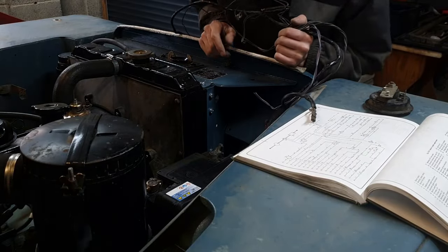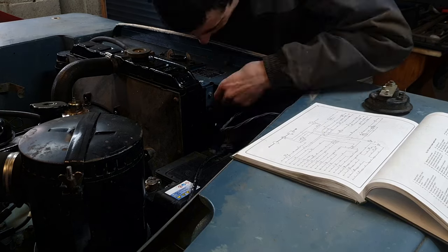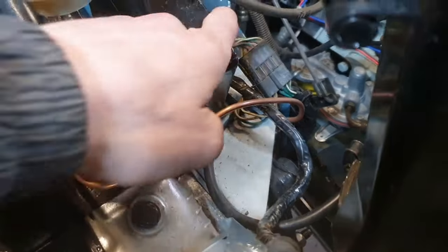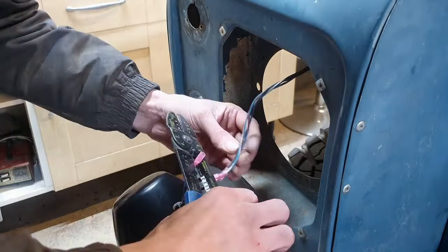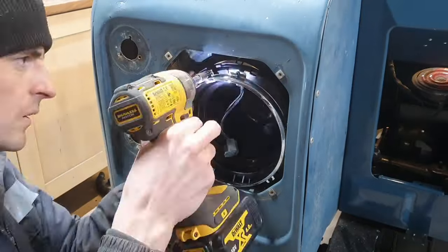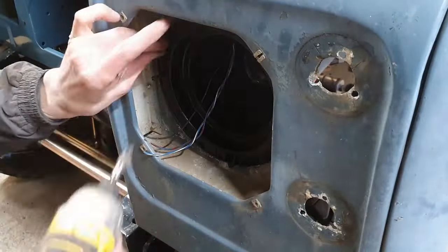I've got to get all this wiring through that little hole there. The front was pretty good actually - quite straightforward compared to the back. I didn't really have to do much fixing or messing around - it just went back together. The new lights and indicators just plugged into the loom. The wiring now comes out of the bulkhead here, goes up the wing with a new P-clip. We've got dip and main, the horn, indicators, and a line to the screen wash. The real wiring work was reconnecting the connectors for the H4 bulbs - the three spade connectors - to the original loom. I cut those off when taking it apart; it was all nasty. I had plenty of heat shrink butt crimps so they all went together pretty easily. The rest was more or less plug and play with the indicators and side lights.